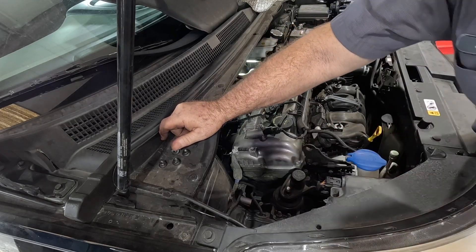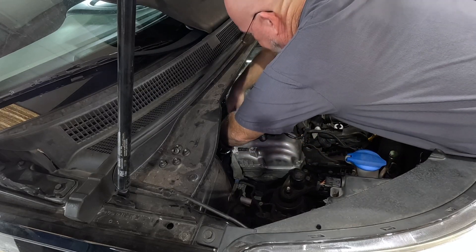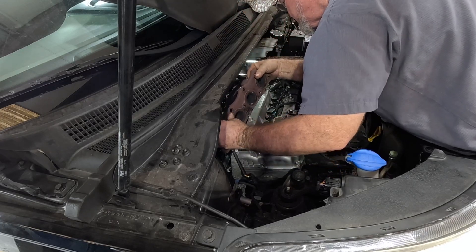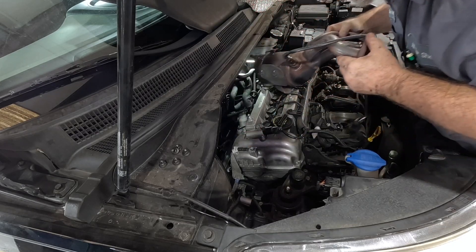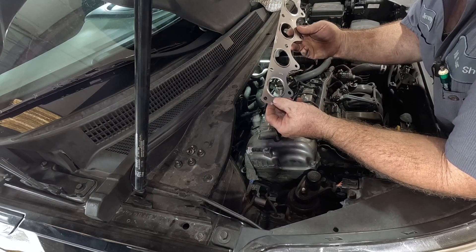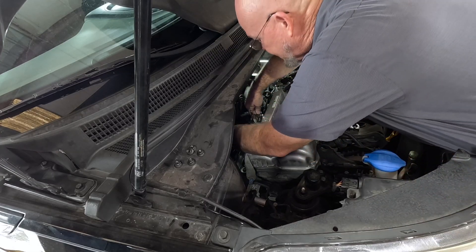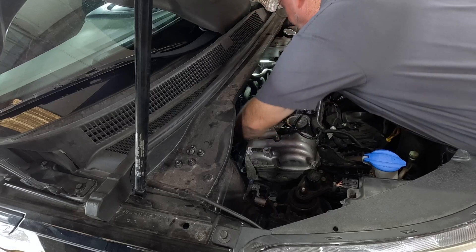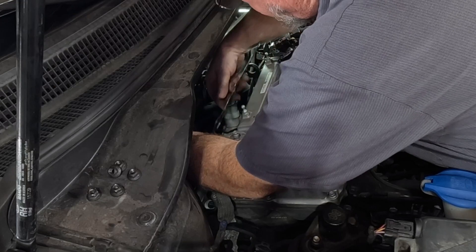This ratchet is really way better than my other one. The old gasket just slides off the studs. These indents face out towards the manifold, so put it back on the same way and the holes should line up. The studs are further out from the bottom, so it has to go that way.